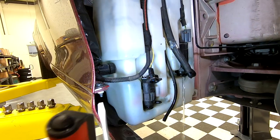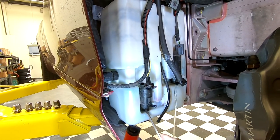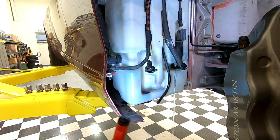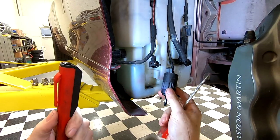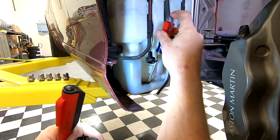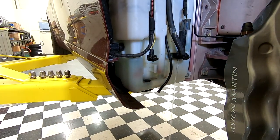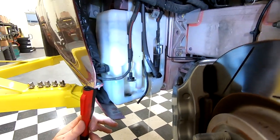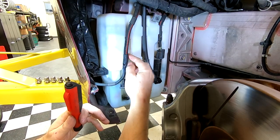That's cool because now with the hose disconnected and the electrical connector, I'm gonna prise this pump up a little bit. And essentially, I'm gonna get it to pop out of the bottom, and that's gonna let this drain a little faster. So there's my pump removed. That's strictly, I'm doing that so that water can bubble up out of the reservoir body, and not have to go through the pump itself. All right, we can tug back that harness out of the groove.